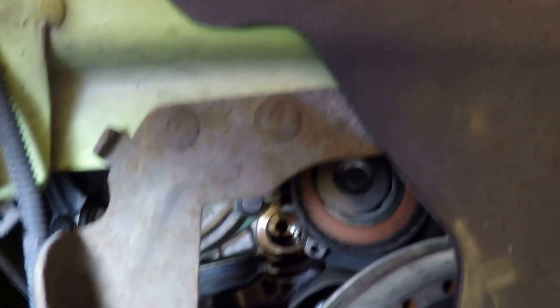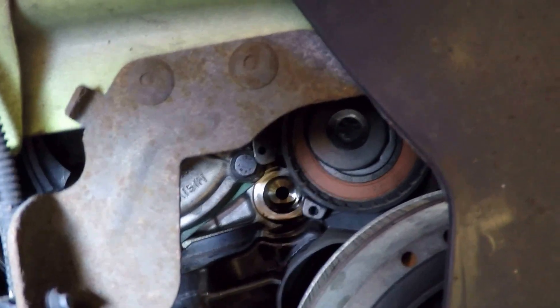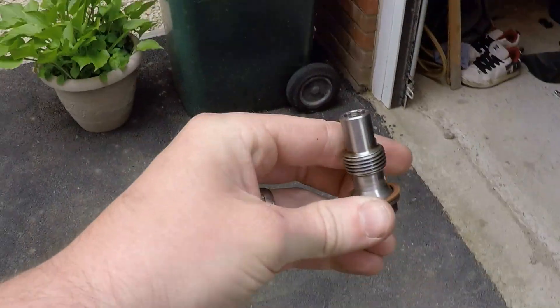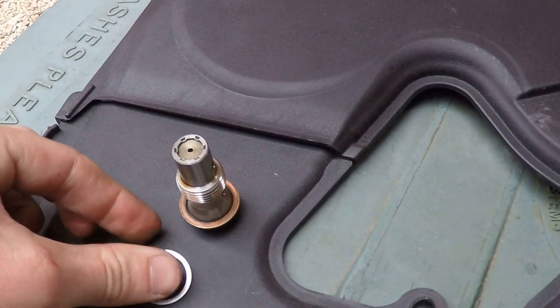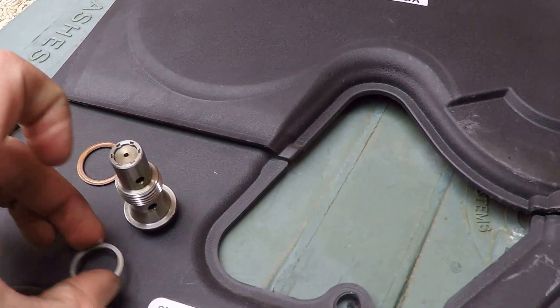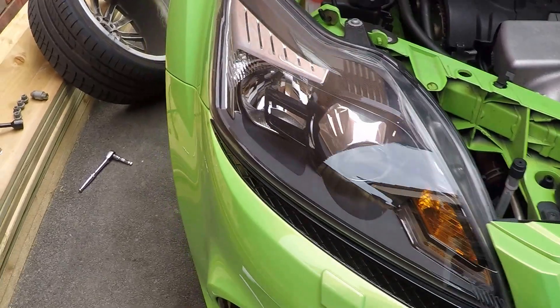You might be lucky if you can just tighten it, that would be great, but in my case and just for peace of mind I'm going to replace the washer. I haven't actually got a copper washer the right size, so what I'm doing is replacing it with an aluminium one which shouldn't make any difference whatsoever. And yeah, basically it's just a case of refit everything.